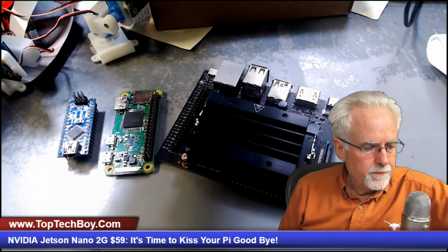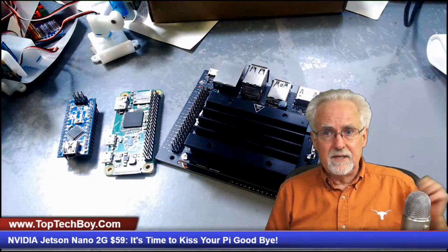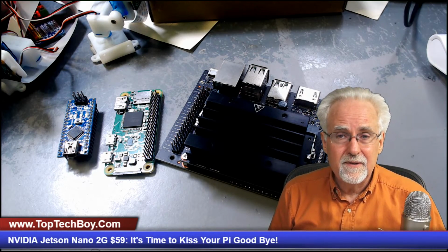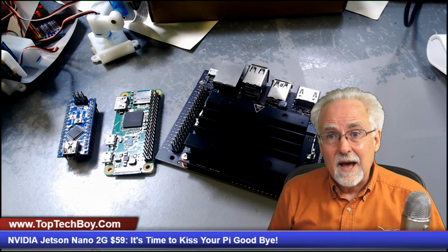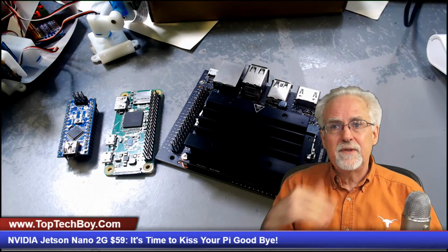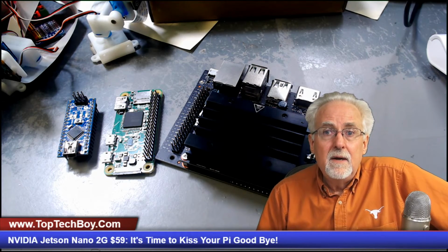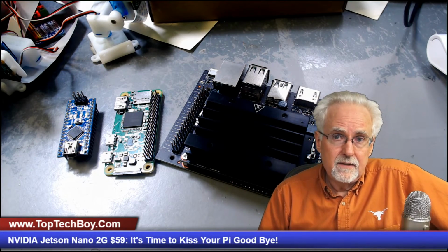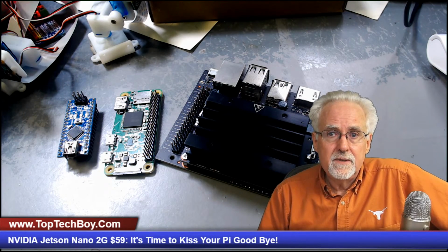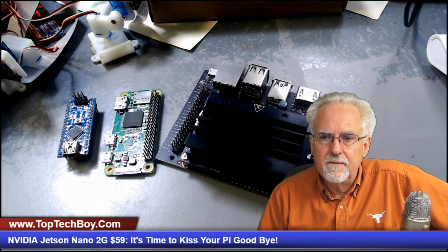Okay, also one of the cool things about the Jetson Xavier NX is you can put the SSD right in the back. You don't have to use one of those. So if you really want to do something like the hot potato type of thing, get the Jetson Xavier NX with an SSD card in the back. Now, people smarter than I might have figured it out since I looked at it, but the last time I looked, there was not a way, or at least not a straightforward way, to boot directly from an SSD without going through the SD card first.